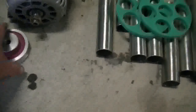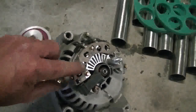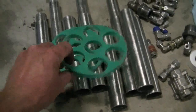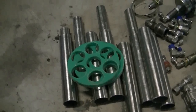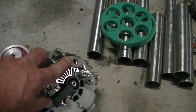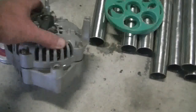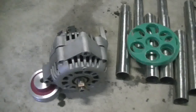Of course we're just going to chuck a pulley on our motor. This alternator is a brand new 100 amp alternator - I've already ripped the voltage regulator off it and exposed the diodes. I was going to run a 6-cell setup but I'm now going to put 7 cells in there, just for that bit extra. We'll be running 3 cells off of one diode, 4 cells off the other diode, and the 3rd winding in the alternator will be used to charge our battery that will be running the spark and electronics on the motor. So we've got our alternator ready to go and our motor sorted out.